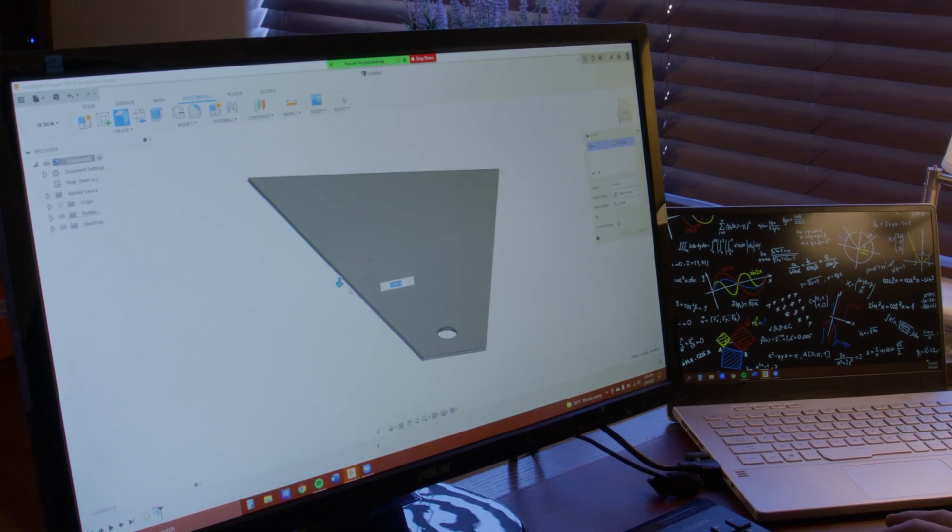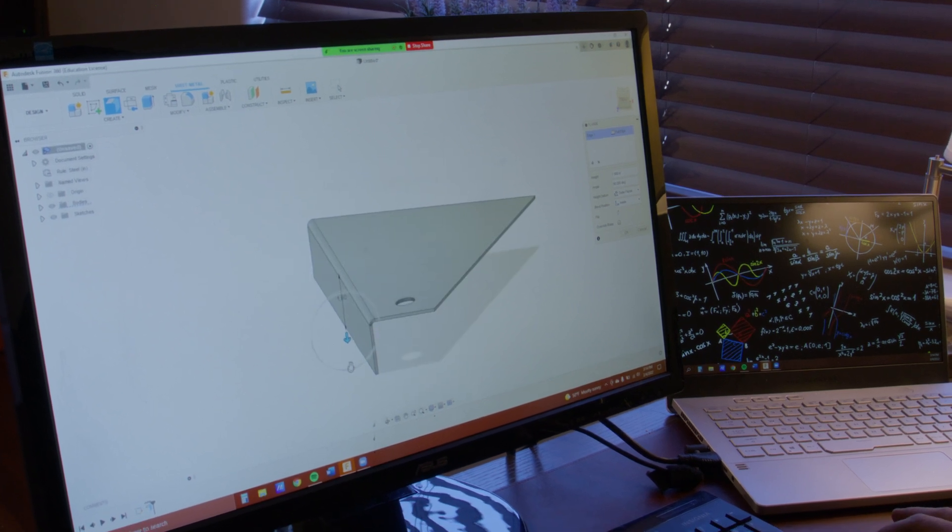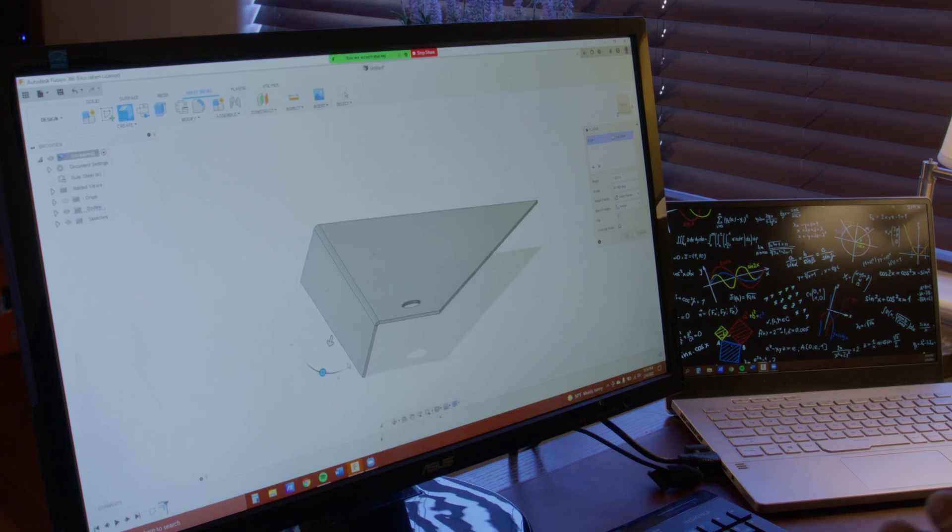We can click in here and start bending these down. What I don't want is for them to be at 90 degrees — I get a little bit of racking at 90. If I open them up and weld them in, there's going to be a little bit more stability side to side. The flange that comes out I'm going to tie into the roll cage using some small one-inch tubing, but that will be further in the build after I get the doors and interior done. Right now I'm just going to assume it's sticking out into no man's land, so I want it to be as stiff as possible.